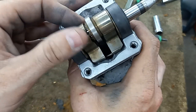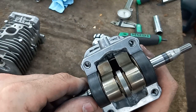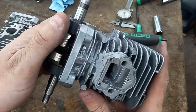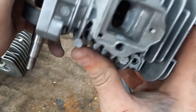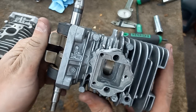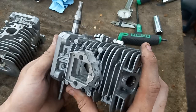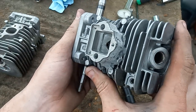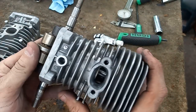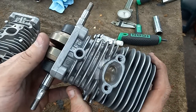And you can see I tried to free up a way to get more fuel up them transfers. I didn't lunge it because the piston goes right to the port. I chose not to cut the piston because this one I was able to cut the cylinder all the way down. As you can see, daylight down there. It'll get fuel. And then there's no free port. I took it just before it would free port.